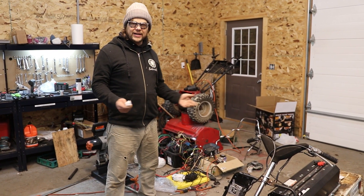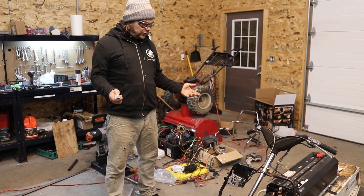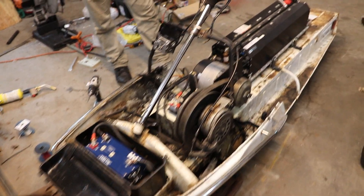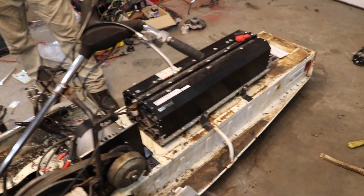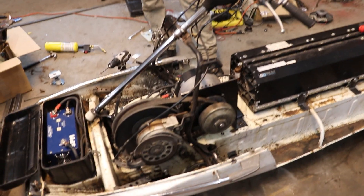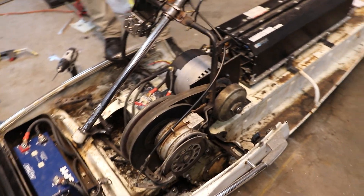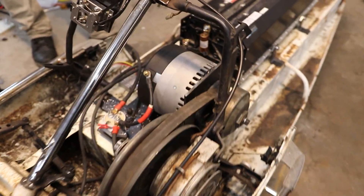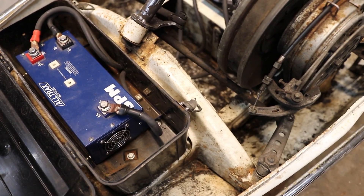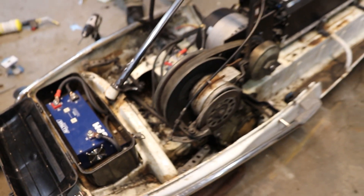All right, check it out — the solar roll of snowmobile. I call it the snowmobiling. We've got ourselves a big old fat battery on the back. It's the same battery we used in the quad — not exactly the same battery, but the same style. We've got a 44 volt ME1004. That thing will pull about 200 amps continuous, probably 400 amps peak. So 20 horsepower — solid 20 horse on here.